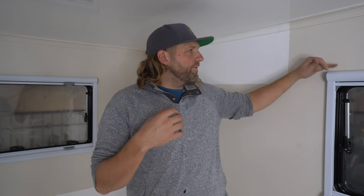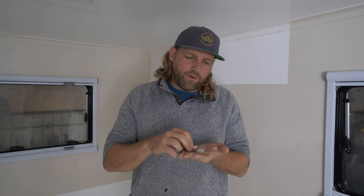So installing these frame assemblies, the instructions said to just screw them into the wall. Now if you have wood or metal, it's going to be a great hold. Ours is just FRP, so we went ahead and tried just into the FRP. It feels really tight right now, and we decided if we feel that it's getting loose over time, we'll go back and put in either a drywall stud, which we could put in with the adhesive, or another little wood plug like we did to set the doors and the hatches. Right now they look really good and they feel really tight to the wall, so we're gonna roll with what we did and see how they hold up.